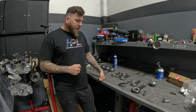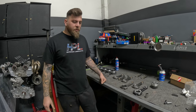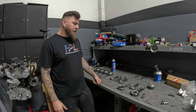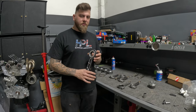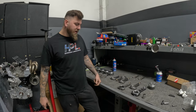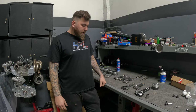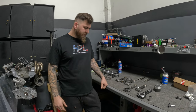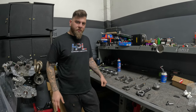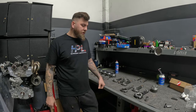Just a couple things to think about — mainly this video was to talk about aluminum rods versus steel rods and why you'd want to use one or the other. I would say to all my customers: by moving to the SPL 1000 — after 1000 horsepower — you want to move to an aluminum rod. And make sure you have the proper fasteners for your aluminum rod, because if you go to an aluminum rod and have crappy fasteners, you're still limited. If you're drag racing, serviceability isn't a big deal because you're going to service your motor anyway. On a street car, stick to your steel rods and don't get carried away. If you're making 700 horsepower and think you're going to make 1100 one day — maybe you will, maybe you won't — it's better to stick with something that's going to be street friendly.